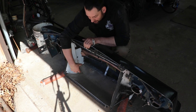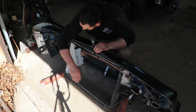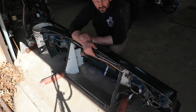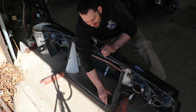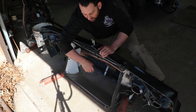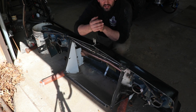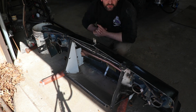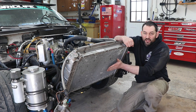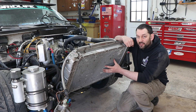So I did this for simplification, and this is my ducting. I'm able to pull air from the two grills and the bumper slot openings, and it all gets forced through the radiator, except for two hoses that are for cooling my brakes as well. If this was a factory setup, there's a huge air gap on both sides, a gap under the radiator, gaps above the radiator, and it's completely open on the bottom. So when high-speed air hits the front of the car, it gets through the grills but then hits the radiator — and it's harder to pass through the radiator than through those wide-open spaces. You end up with air building up in front of the radiator creating a high-pressure zone, so it just flows around the radiator and there's not a lot of air actually getting through it.